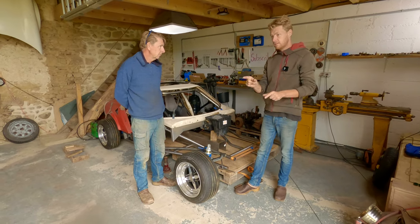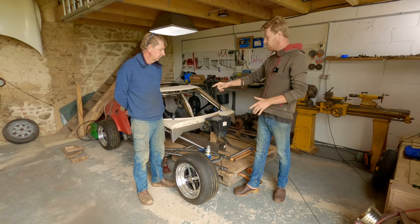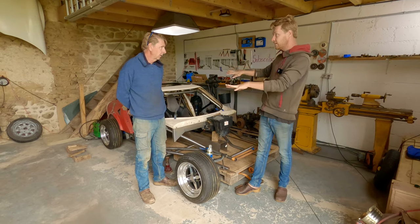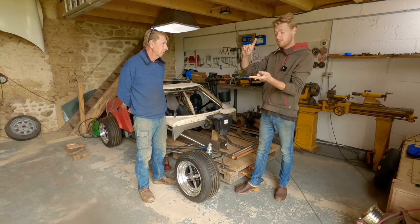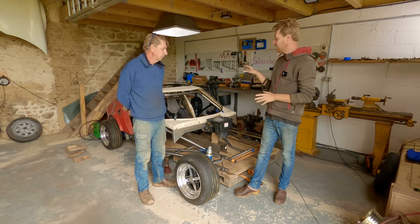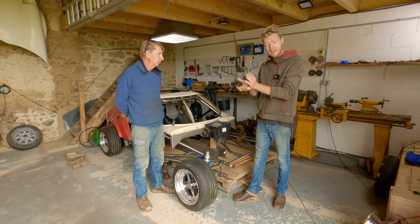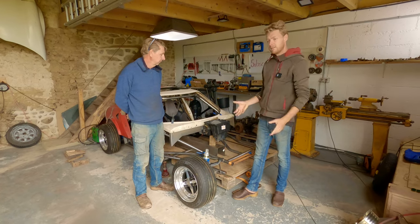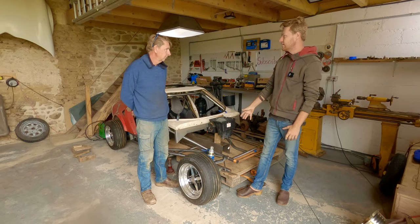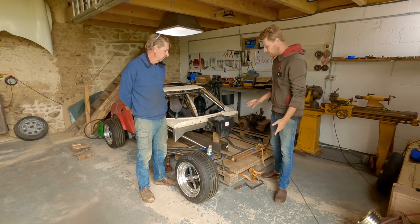And there's a bunch of things that, until we've got the car on corner balancing scales, I don't want to situate. There's a bunch of things that you can move around in order to get your weighting perfect before you start messing around. You've got your battery, your screen wash bottle, and your spare tire, and a couple of other things. A screen wash bottle doesn't seem like much, but if it holds a litre, that's a kilo. Even a lithium battery is 2 kilos. Your spare tire is 9.5 kilos, this little space saver. And so that might not seem like a lot.